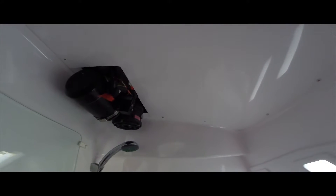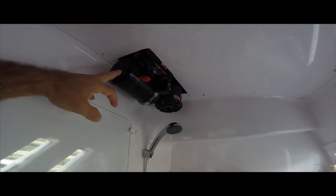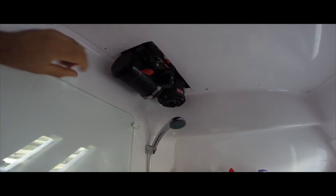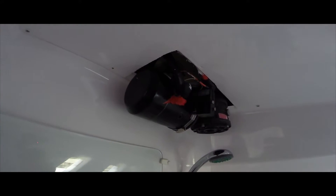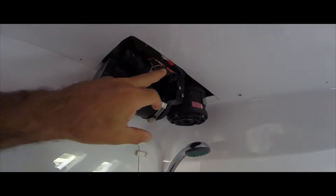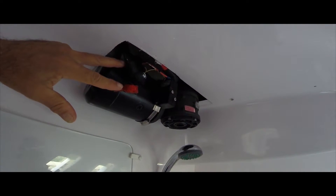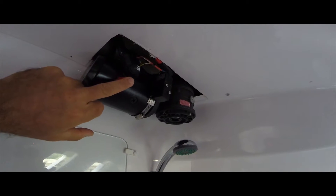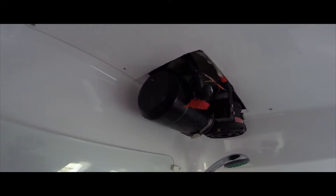Here's the install so far - we've got the winch set up, put the headliner back on. There's another headliner that goes over here and I'm just about to put it on. First I'll test the winch to make sure it's working before I put this headliner on - it's just a small cover that goes over here. I had a bit of problems reading the diagram, so if you ever do this yourself: that is positive - positive goes to a relay system. There are actually three terminals here - this one isn't used at all. The middle one is negative. So if you're wiring this up yourself, that's the setup.